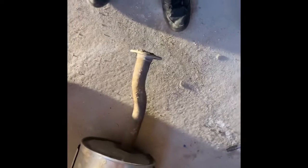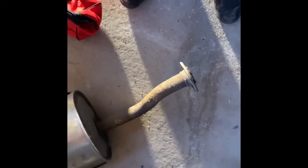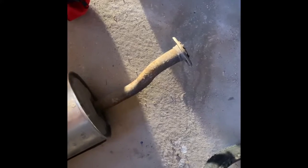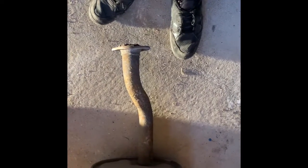If you've been keeping up with my last video, I said I was gonna get a new pipe like this shaft, but unfortunately I think it's just gonna take too long to get that done. What I'm gonna do is use this one more - I'll just grind it off down here, grind off this flange, and put one of the new ones on, just a simple MIG weld hopefully. Some pipe was lost when I cut off the old flange because it was really hard for me to get under the car and cut the proper size.